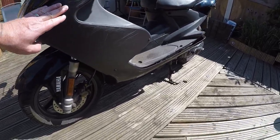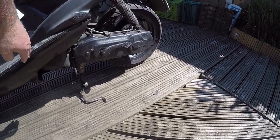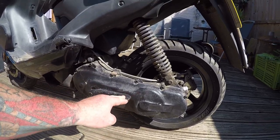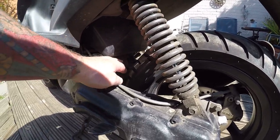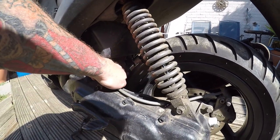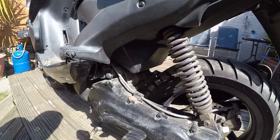On this Aerox - scratches all down here, we're going to blow those over. This is knackered so we'll cable tie it, glue it, and do it properly. The variator system - the clutch is in the same place, variator in the same place, and the belt. Check that out - although this does go. It's got a nice little kick start that works. Now the one thing I don't like about the old Aerox is where the electric starter is - right here, easy to get on and off, but this little cable connection gets water in there and just stops working. It's a known fault these have.